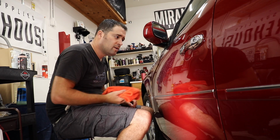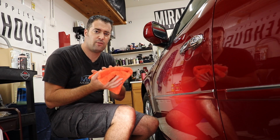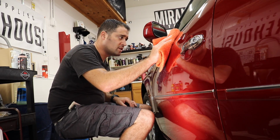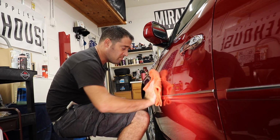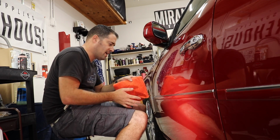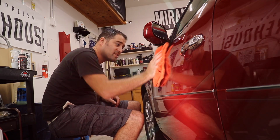Now when you're finished polishing like this, again on delicate paint, use a light touch with your towel. Even with the fluffiest towel, sometimes the residue can cause minor marring in your paint. So use a delicate touch and wipe off very gently. The polish will be removed. Just take your time removing the residue. You'll get that layer by layer. And then the results, amazing.